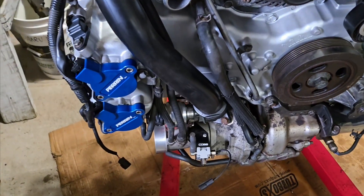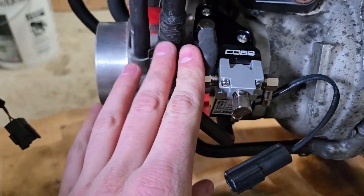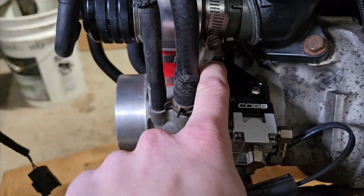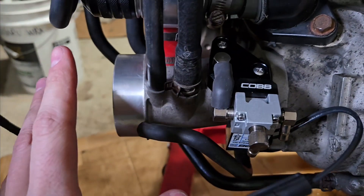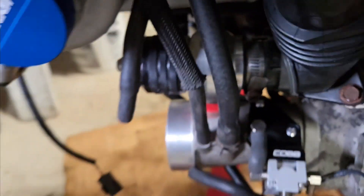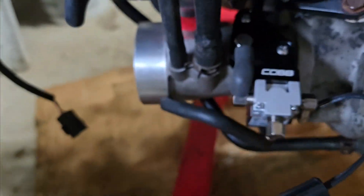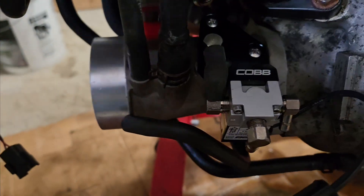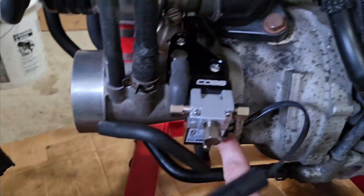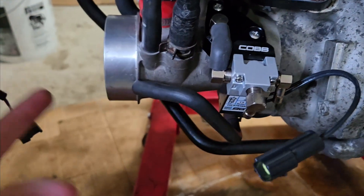I have the engine pulled out of the car, so it's nice and easy to see everything. You don't need to remove your turbo inlet to do this, though it is easier because you can get more space — especially with the bypass valve sitting on top. This is hard to do unless you have a bent screwdriver, which allows you to get in there without removing the inlet. If you do need to remove the turbo inlet, it's not too bad — just two bolts holding it into the actual turbo and some hoses to disconnect.